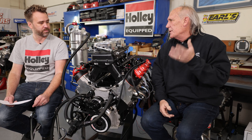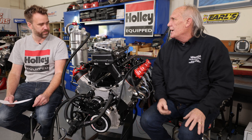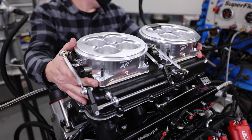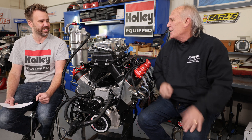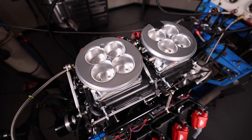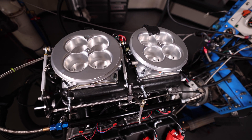When something is honestly just plain too big, you'll see a peak number pick up by four or five horsepower, but the sacrifice in drivability is generally not worth it. With this much throttle body, at 50% throttle or more we're pretty much at all the air that motor will ever need, so drivability becomes a big issue. It's like back in the 80s — a big throttle body feels really snappy but doesn't do anything from three-quarter throttle on. In a drag race application only this is fine, but on the street there's a lot of surface area that opens all at once and it's going to make it really touchy to drive.